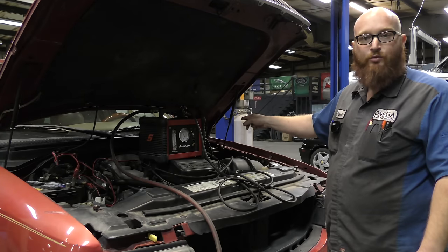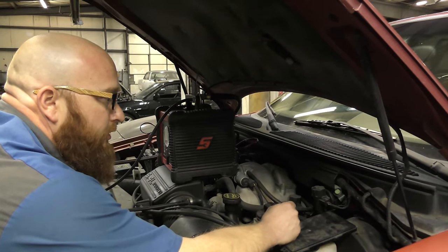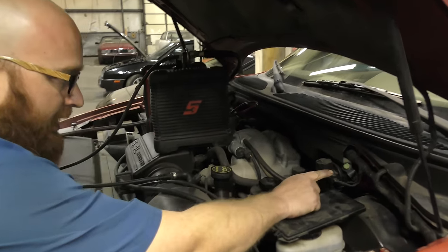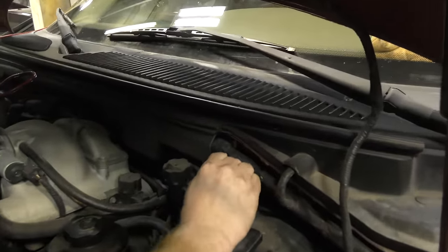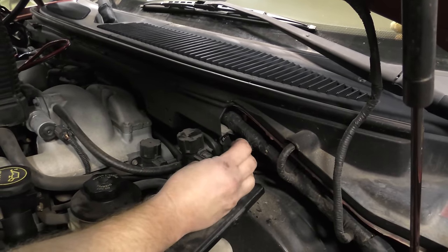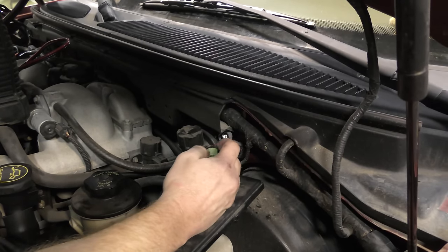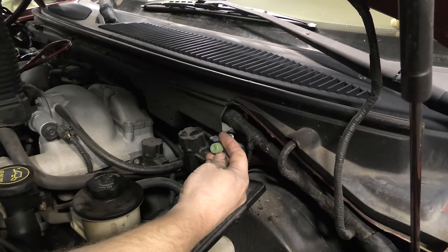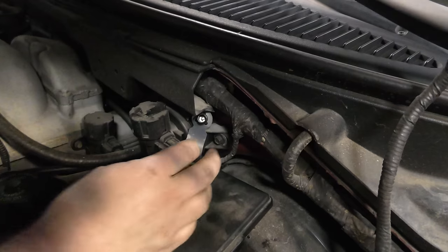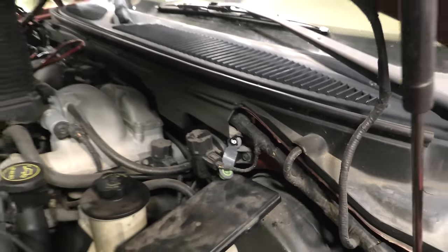When that light comes on, that's where this comes in handy. Let's move over to the EVAP test port. This is Crazy D's Lincoln Navigator that he got for free from Hoovy — that's what we're using today. There's a little green cap that is strictly for your EVAP system. Sometimes you'll see a little tag on these that says EVAP test port, do not exceed 1 PSI. You don't have to worry about it on this machine — it doesn't exceed that. It's like half PSI.